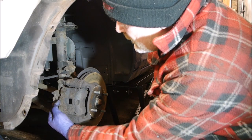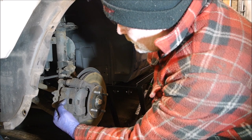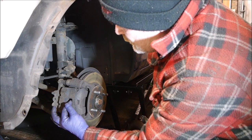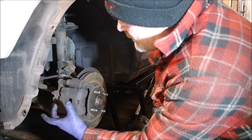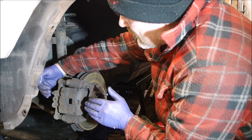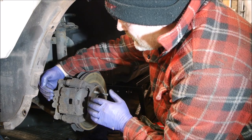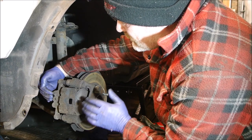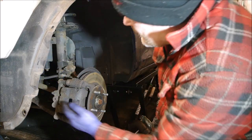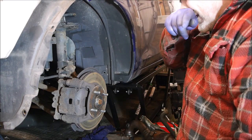This is a very simple brake caliper — there's just a piston on one side. This is called a sliding caliper. Basically the piston pushes out on one side, pushes the pad onto the disc, and then as it keeps pushing it slides the whole caliper across and pulls the pad onto the other side. It's not like dual pistons — there is a momentary, milliseconds reaction between one gripping and the other pulling in, so sometimes you can find uneven wear, especially if the sliders are stuck.